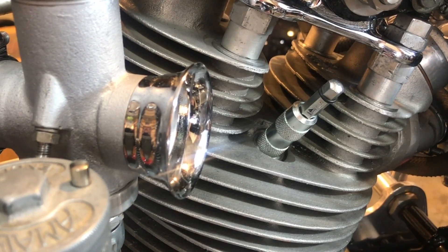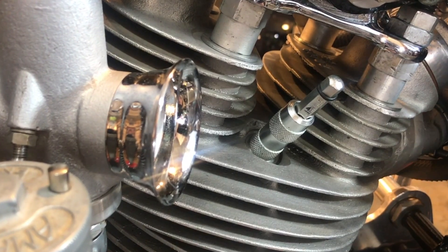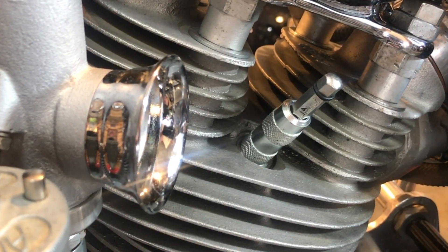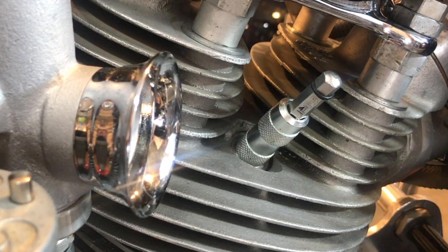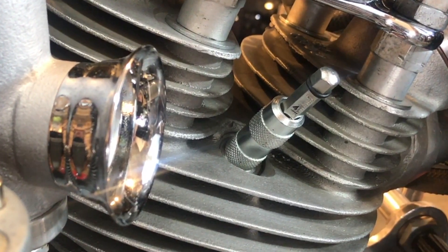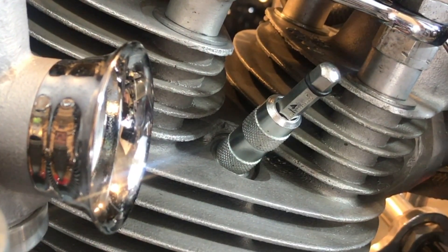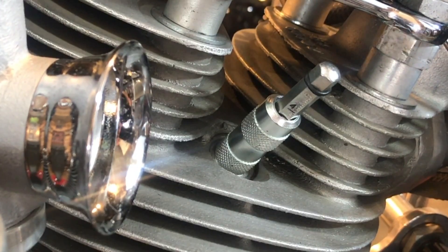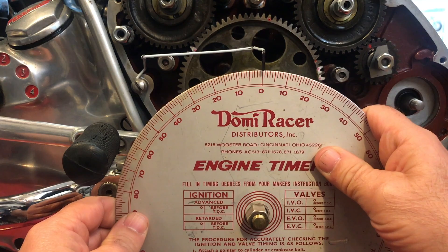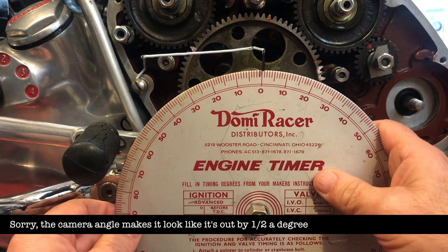It's still rising... and then it stopped. It's now returning back down. So in that moment of stopping was top dead center. I'm going to go back, and I'll leave it there and call that top dead center for now. Let's assume that was exactly top dead center. Resetting to zero there.